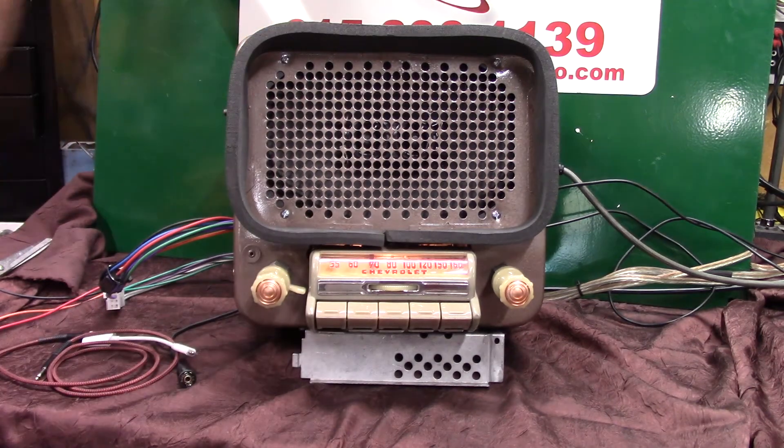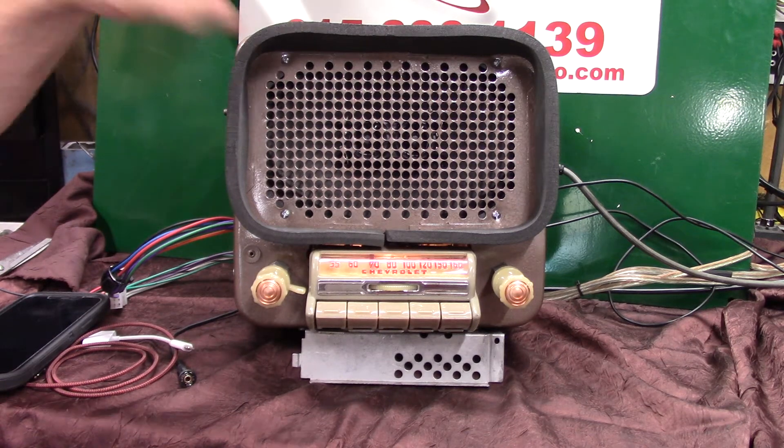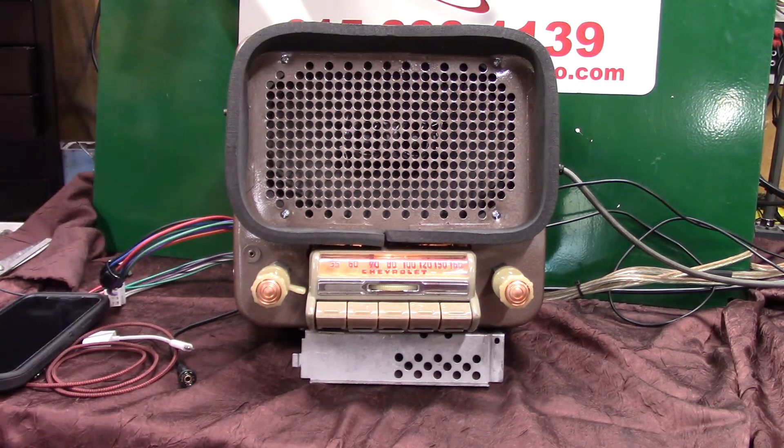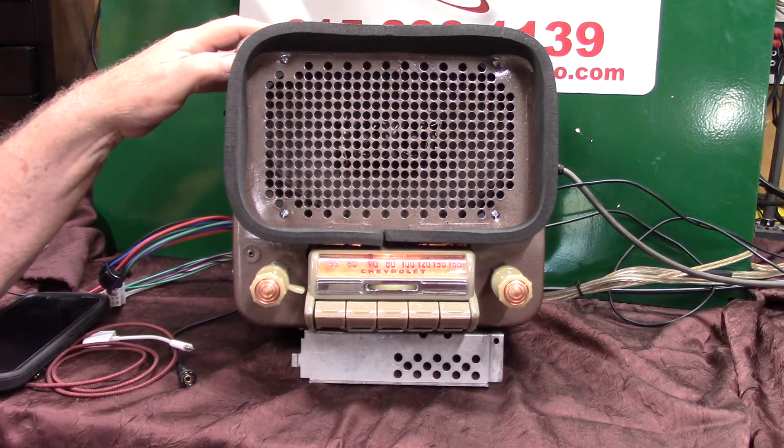The original 1948 Fleetline with original AM radio. We've done a complete restore on the case, a new full-range six-by-nine DVC stereo speaker. It has four channels out, 45 watts a channel — two here, two elsewhere. It also has a set of pre-outs on the side if you want to add an amp to rear speakers or even put a sub in. AM/FM stereo, auxiliary in.